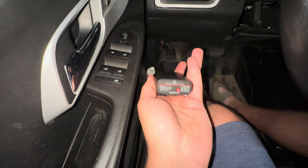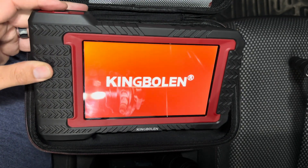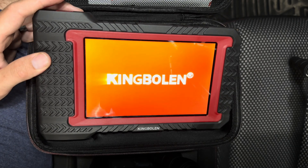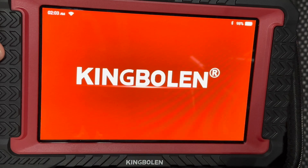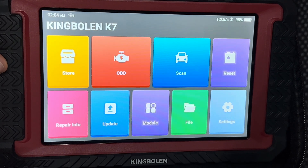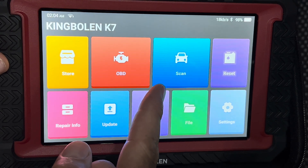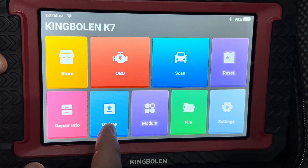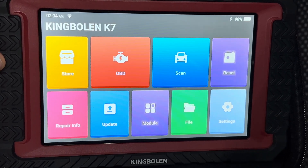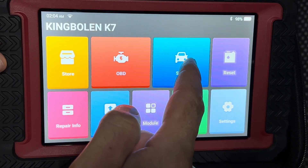We take our wireless dongle and plug it in. Press and hold the power button to power the unit on. These are your functions on the main menu — I went ahead and set it up off camera, so you just follow the steps to do that when you activate it and turn it on for the first time. We're going to walk you through a quick demo. First we're going to start with a simple scan — we'll walk you through some more detail later. We're going to turn the ignition to the on position with the engine off, then hit the scan button.